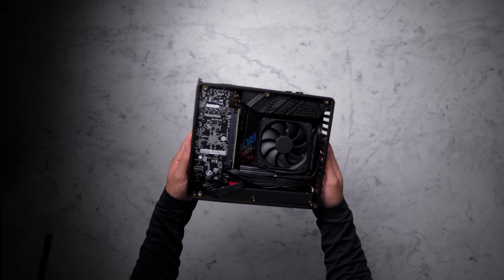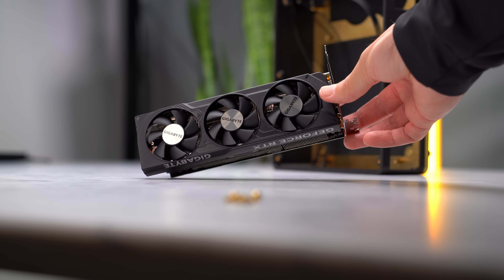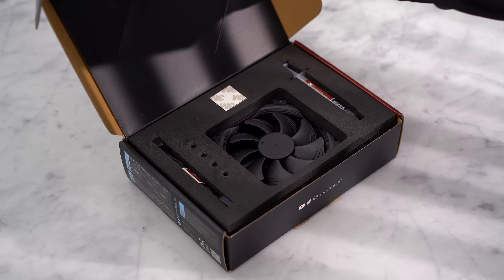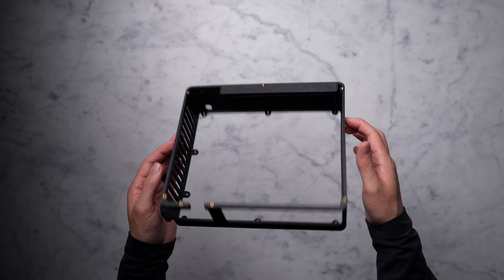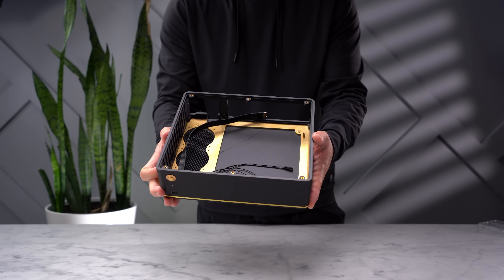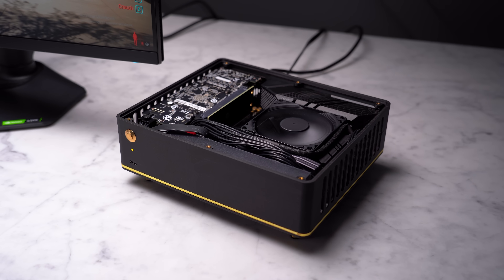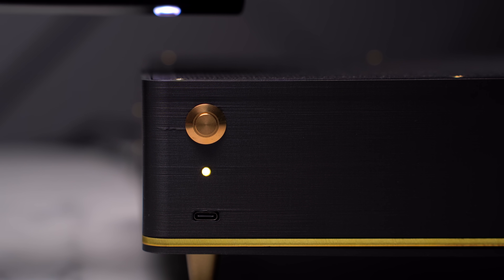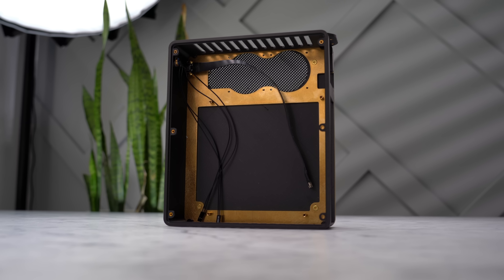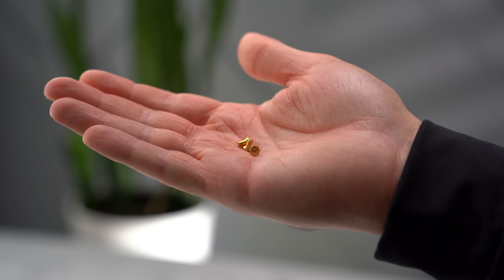This is an incredibly small case, and it's very smartly designed to fit any mini-ITX motherboard, along with a low-profile GPU up to 185mm in length, the HD-Plex 250, and a CPU cooler up to 40mm in height. They also have a Yokto Plus — that option is slightly taller to accommodate a 48mm CPU cooler and a 2.5-inch drive, while still being super small at 4 liters. It's also got a very classy design in my opinion. It's got an all-black aesthetic and brass accents, a satisfying and clicky power button, and a large brass base plate across the bottom which gives the whole case rigidity and also shows as a thin brass line across the front. Even the included screws are brass to tie in with the whole aesthetic.